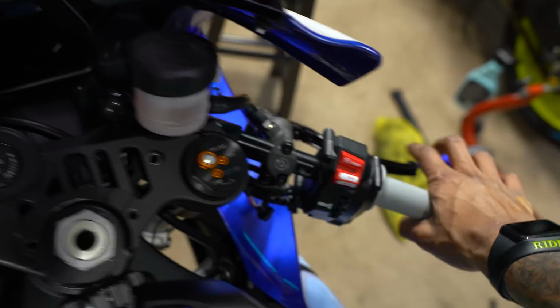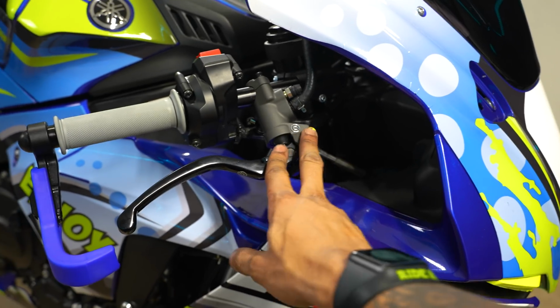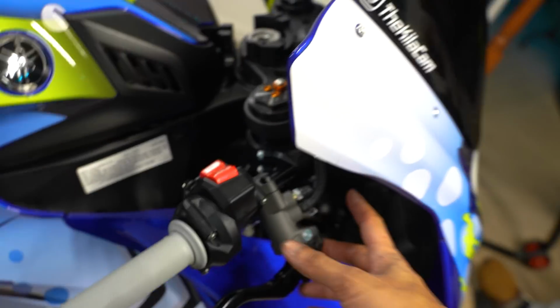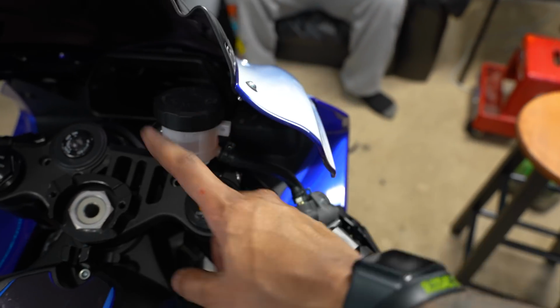The master is done. I did not film this for you guys because there's a million videos out there on swapping out a master cylinder. The Brembo 19x18 is on. I had to create my own hose, because the stock OEM hose was just not long enough. So I ran one here just for now until I get another brake reservoir with a longer hose.